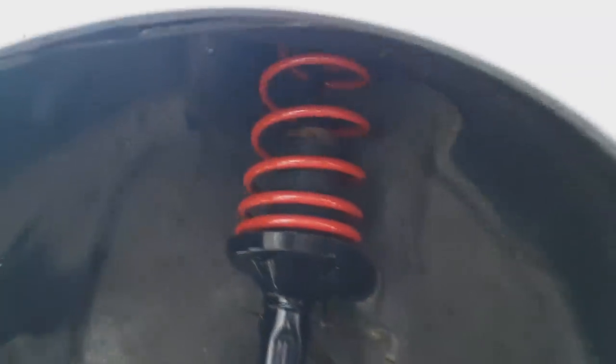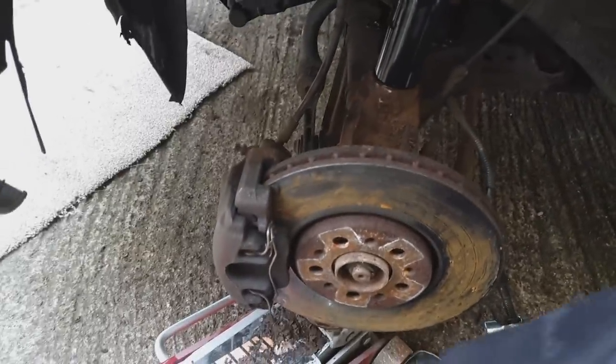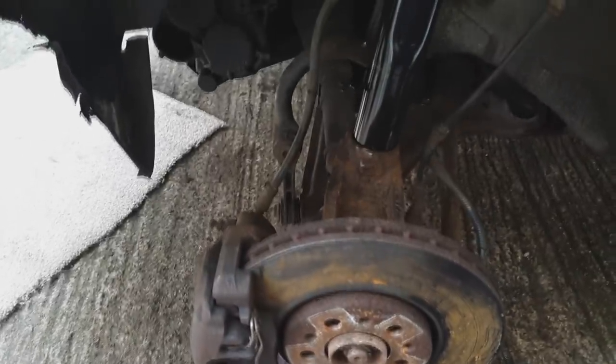The new strut is in place — the spring is still where it should be, top nut on but not yet tight. You can see that hook piece at the back which drops into the slot. I'm going to put my jack underneath the bottom ball joint and gradually lever this up to squash it in. I put it under pressure, tapped the metal, and then it went in — sunk nice and tight. I've already tightened the top nut but I'll check it one last time. Then plumb all your pipes back in, put the bolt in, put your wheel on — done. One corner complete, three more to go.